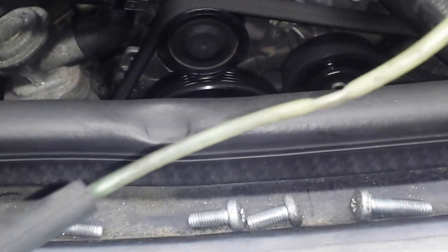Alright ladies and gentlemen, in troubleshooting this secondary air pump, I said let me take a look at these hoses that run right underneath it. This hose right here that runs right underneath the secondary air pump — I took off the secondary air pump when I was doing the mass airflow sensor and air intake replacement. Look at this hose: when I put it back together, it's been squished, squashed, shut off. And that's been giving me the secondary air pump failure.